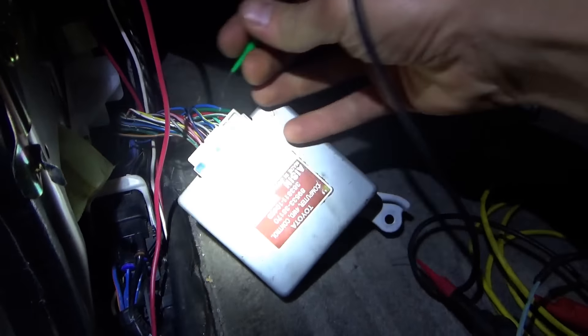Let's see where this switch lives and we can even unplug it, ground it, and see if this thing stops blinking. Here are the two switches - the yellow one is for the differential lock position 4HL, and the red one is just for 4-wheel drive regular free. There's the red and black wire, pin 6. I'm going to ground it out through a fuse - that's what the switch is supposed to do. Pin 6 with our test light - yes it is grounded.